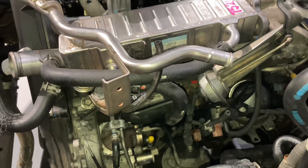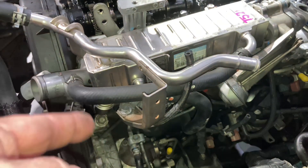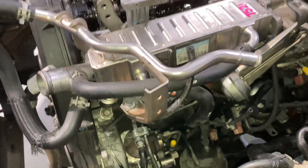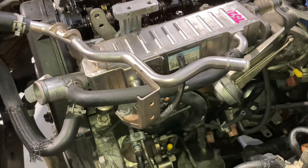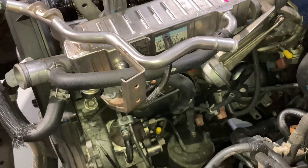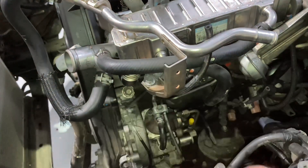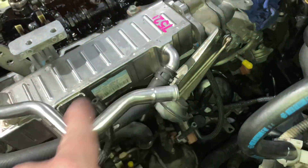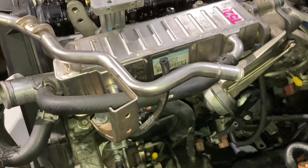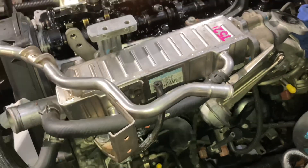I'm not going to be the guy using common sense for 10 seconds saying 'yeah that should be right mate' — I need to think about it more. I'm seriously considering doing it on my own vehicle. A lot of people already have reduced EGR flow with a plate with a 7mm hole behind there, which means there's not many exhaust gases to cool down. By having less flow and hotter gases that's probably what you want. But I really don't know — if you cap the coolant off, it's just air in there. Cap it off and nothing's going in — but is the heat of the exhaust flow going to damage the cooler somehow?